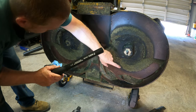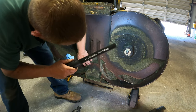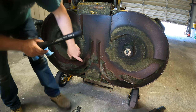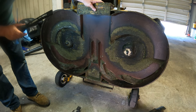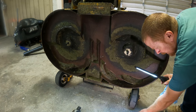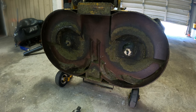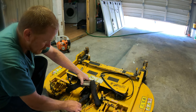Doing a good visual inspection of the baffles — all here for a reason. Going to scrape out the grass to get a better look, but everything appears in good shape underneath — no holes visible. The deck shell itself is in pretty good shape, looks like a couple of incidents here and there but nothing major. I'd say at least two to three years of life left in it. We do want to take care of the gearbox leaks, because that is the lowest point of the gearbox — that lower seal. We'll also inspect the upper inputs to see if those are leaking.